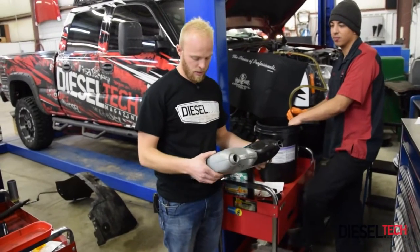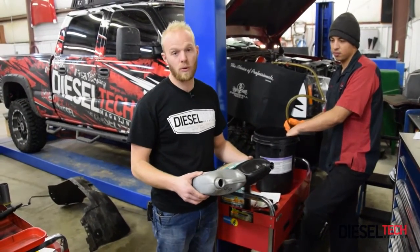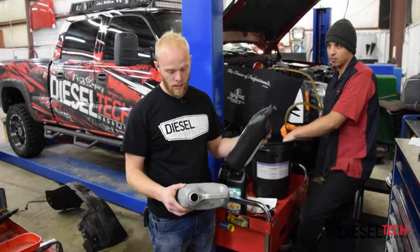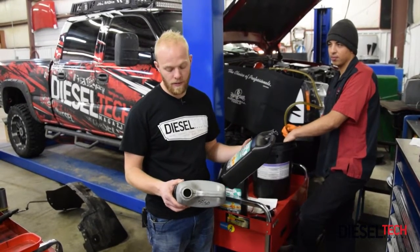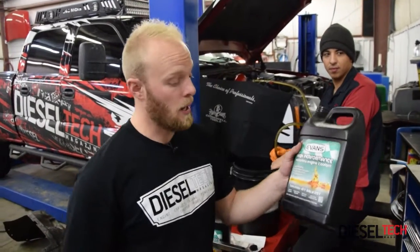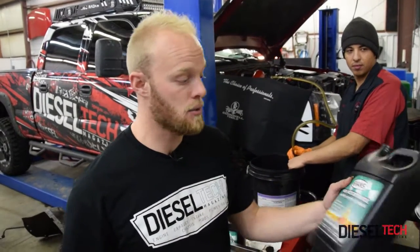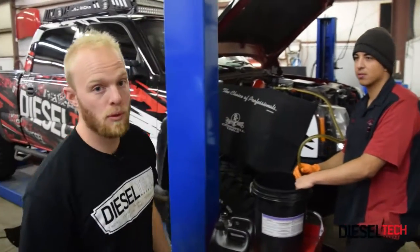I just want to tell you guys some cool statistics with it, though. A normal coolant mixed at a 50-50 ratio only has a negative 34 degrees Fahrenheit freezing point, whereas Evans has a negative 40. And then the boil over point on a 50-50 is 265 degrees Fahrenheit, and the Evans has 375 degrees Fahrenheit. So in every way, freezing to boiling, it's got a much wider range, which will benefit your truck greatly. So we're excited to see it in the truck and see how it performs.